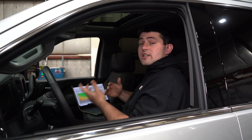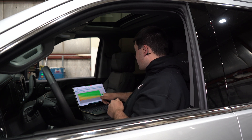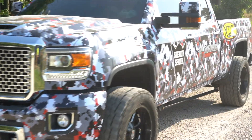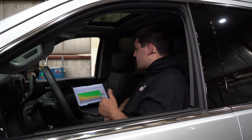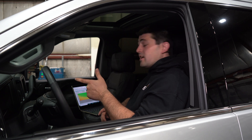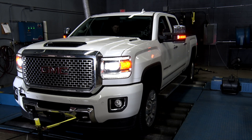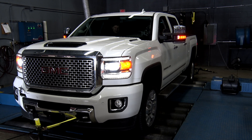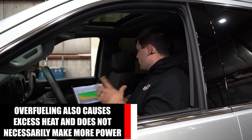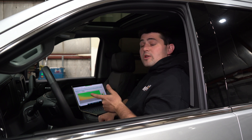To start, we're basically going to get torque-to-fuel, or in common terms, pedal to torque. You take that fuel volume in MM3 — we're going to be at 150 MM3 on a stock truck, about 1,750 to 1,580 µs pulse width — and then you get into where does that line up with what we're allowing the truck to make for torque. Torque on these trucks is just a reference of full load. Earlier we talked about efficiency and air-fuel ratio — that's the balance we've got to work with between the turbocharger and how much air we can bring in and the fuel and how much we can give it. Certain trucks — the turbocharger will support 600 horsepower, but you only have 550 horsepower worth of injector. The L5P is a little bit different. We run out of turbo on an efficient setup at about 550 horsepower, but we have enough fuel to do about 700 horsepower. So this is where we really have to be careful — we add too much fuel, it's going to make a mess in the DPF. We've really got to use the factory systems and the air-fuel ratio and optimize that AFR to get the power we want, but not push it too far where you're losing reliability and getting frequent regens.